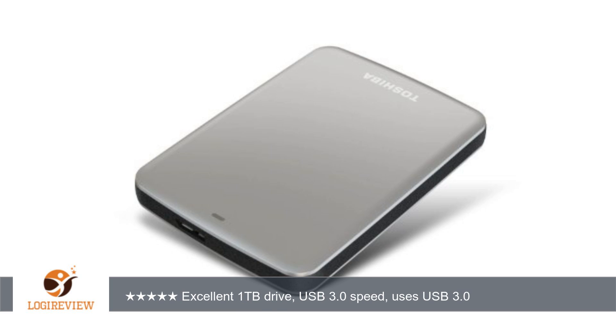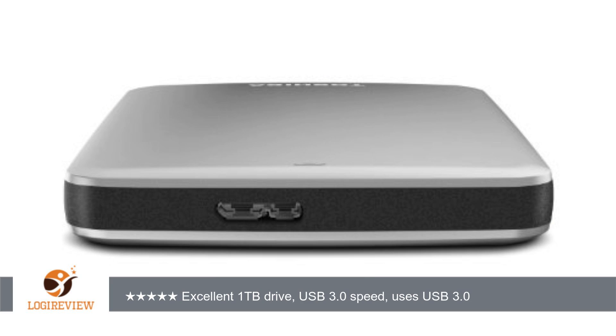So far so good. I've had the 1TB Canvio Connect plugged in for 3 days now to my 3-year-old Windows 7 laptop with USB 2.0 ports. I've transferred, deleted, and re-transferred 75GB of MP3s. I've had it hooked up directly to the USB port and also through a cheap Belkin 4-port USB hub. The transfer rate for USB 2.0 for me is 13MB per second. The drive is nearly silent, did not get warm during transfers, and so far has given me zero issues.